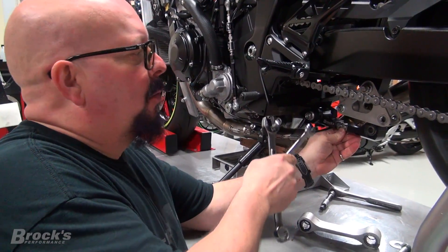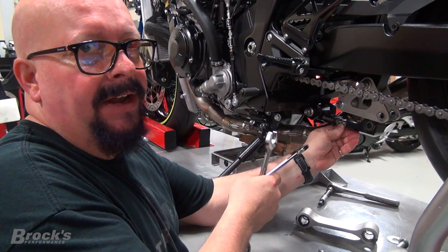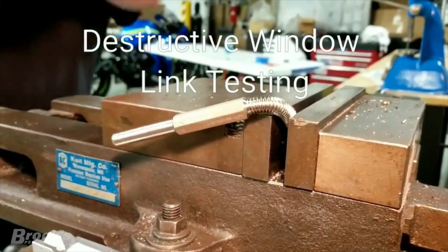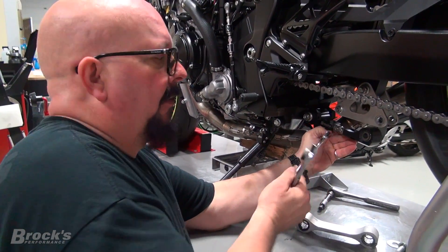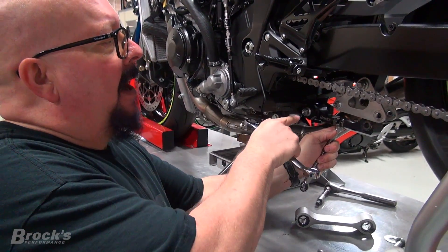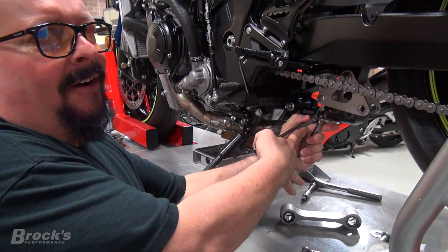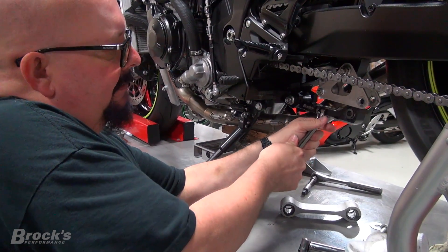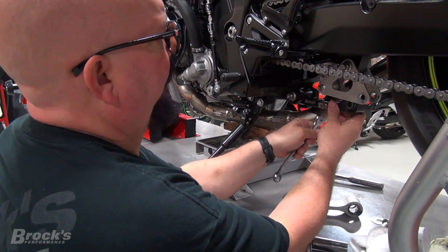We use a very specific steel - super strong - and I don't know if you've ever seen a video where I can bend these things 90 degrees; they won't break, they're really, really tough. It starts its life as 5/8 hex rod, so we're going to use a 5/8 wrench in the center. The L, if you can remember it - these are right and left hand threads. If we just loosen the L in the direction of the L, we just loosen that one. Same thing here. Now we are going to loosen or lengthen this rod to try to get it lined up.